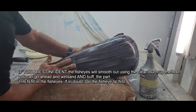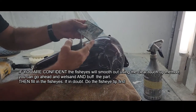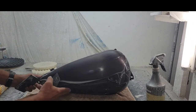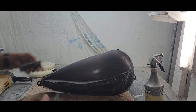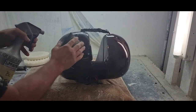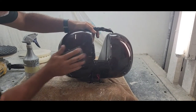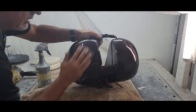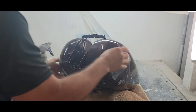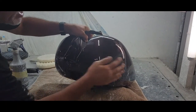Okay, we can check this — this is part 5517, about a four-inch 3M squeegee. Squeegee this down. You want it completely dull; any shiny spots would be either orange peel or hopefully not a run or pits in Bondo. Hopefully you don't have those, that would be a problem. Sometimes you can fill those in with clear coat. Make sure you get the front real good. Okay, I'm confident that's good — let's keep turning the tank.